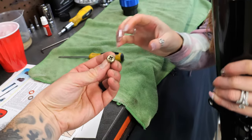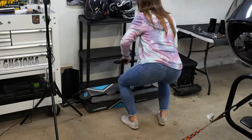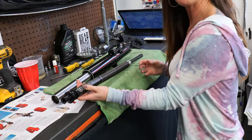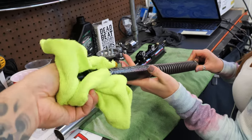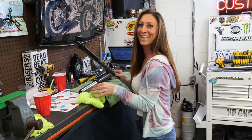There's a little screw right there that goes on the side. I put a brand new copper washer — brought a whole kit of them. Now we're almost done with this fork leg. One thing to mention: be careful with styrofoam around here because styrofoam can ruin a seal. Make sure you wipe down all the styrofoam and stuff from the kit off that spring before it goes in.